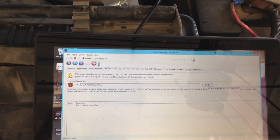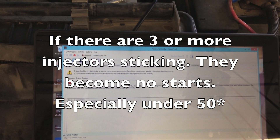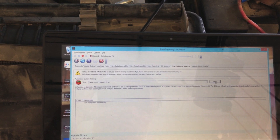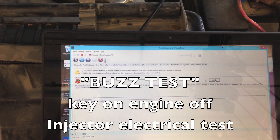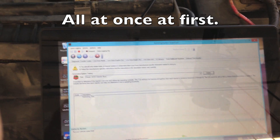While the engine is really cold and has not yet been started today—it's probably in the 60s here—I'm going to go ahead and do the buzz test. We also count to see which cylinders it is. We want to hear a nice sharp clatter. If it sounds muffled, then that injector's sticking. So here with the Auto Ingenuity I'm going to go ahead and initiate the buzz test.